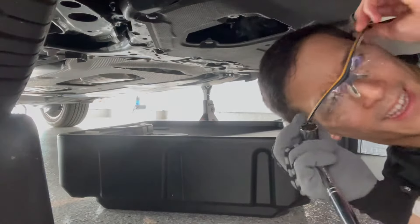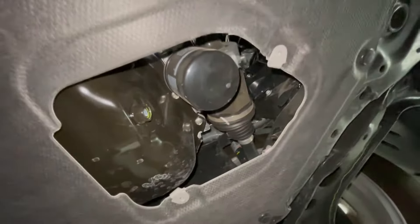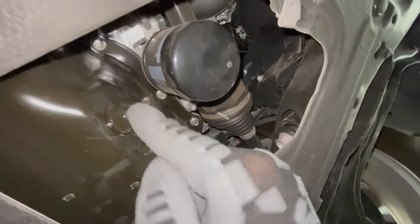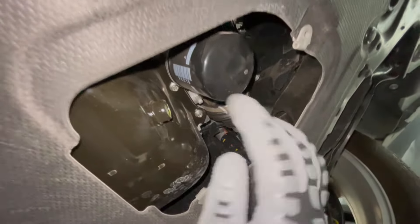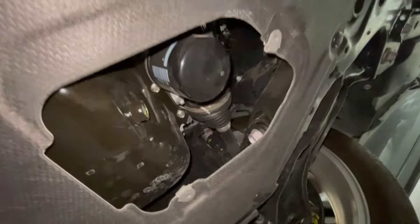I forgot my safety glasses — time to look like a dork, but be safe. We've opened up this cover and you can see that Mazda designed this really well. The oil filter is right there, super easy to get to, and the drain plug is on the backside. That means when you drive your car up onto ramps, the car is tilted and this drain plug is in the perfect position to allow all the oil to drain out. Some cars have the drain plug on the side of the oil pan — this one's in the back, so that's awesome.